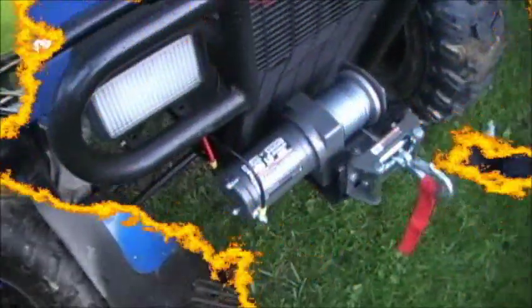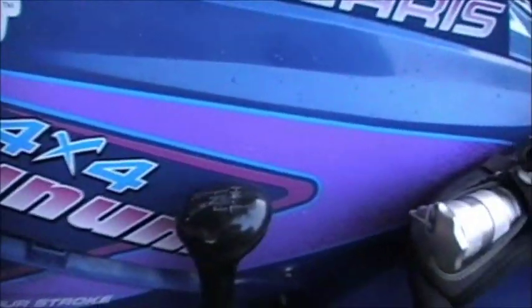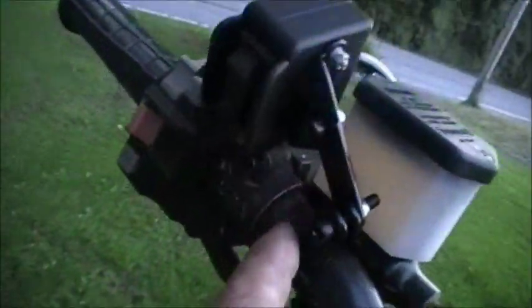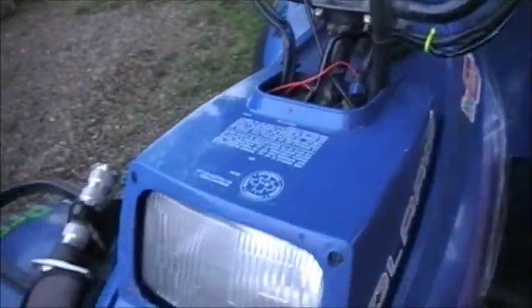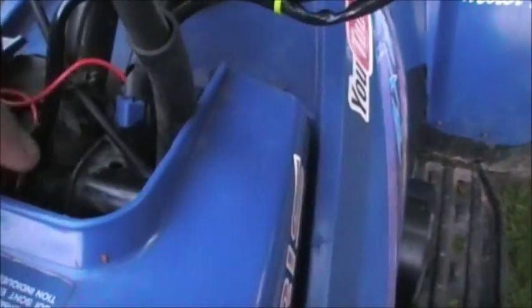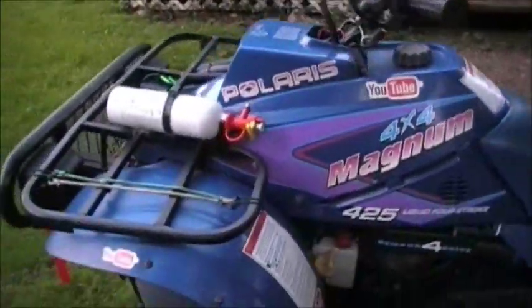I said forget it and went ahead and mounted the switch. For the switch wires I went through the radiator area — I took off this cowling piece, which is no big deal. A screw here, a couple screws for your gas tank cover, and this pops right off. I just ran the switch up here; they give you a nice little bracket so I mounted the switch left-handed so I can still use my throttle and shift at the same time. The little red wire provides power to the switch from the ignition — I took my tester, found the red wire, and that's the positive one that gives power when you turn the key on.